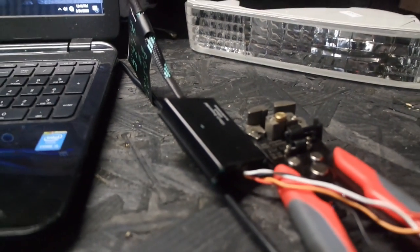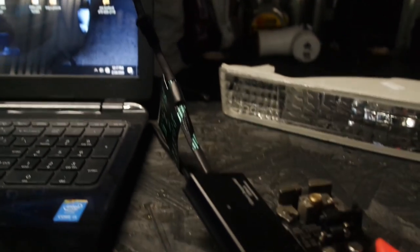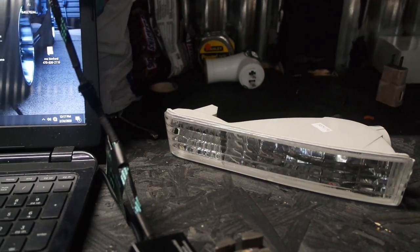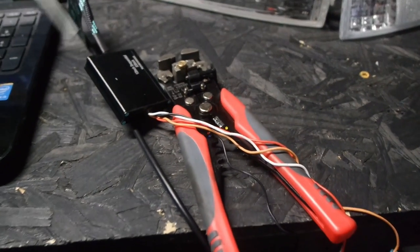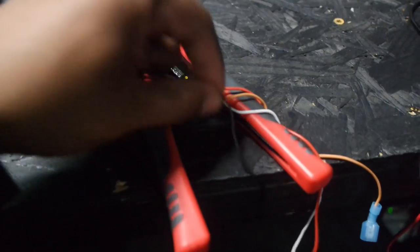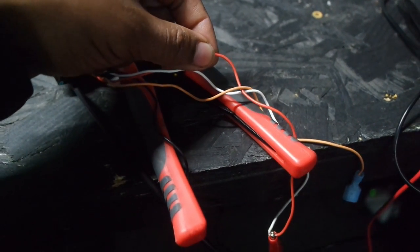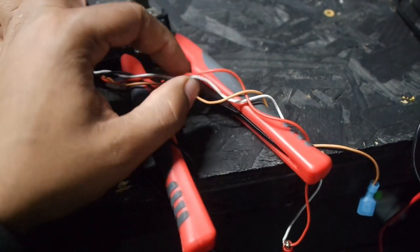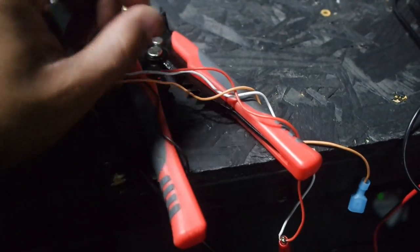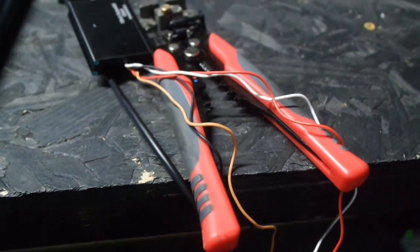This is the conversion box right here, and this end plugs directly into the light. The reason why I chose these specific lights is because they were pretty much plug and play. There is a little bit of wiring — when you get to that point, this box will have to be wired into your stock harness. But it's just four wires: you got your ground, the red is your power. The white and the red are going to the same power source — one powers the box and one powers the running light, the white light. The yellow or orange wire is the turn signal. It's pretty simple, just four wires you got to wire up to the stock harness.